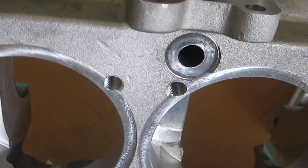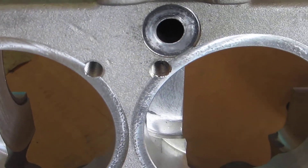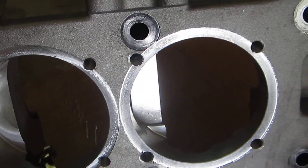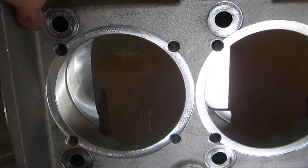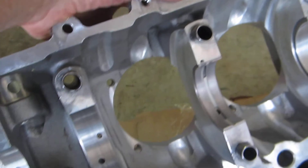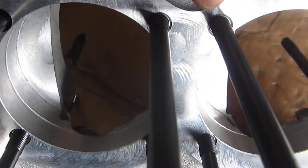Jumping back to the TF1 case — the case savers are 10mm, but there are no case savers installed because this case doesn't need them. It's a very strong case, capable of supporting 400 horsepower. Precision Alloys doesn't use case savers. This case is cut for 94s and clearly built for the big stroke crank — the 86 crank.